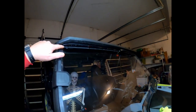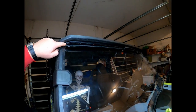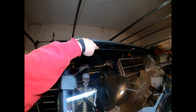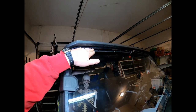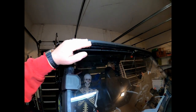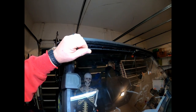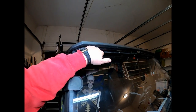I decided I needed something to give it just a little bit of stiffness — something to help it stay in place. What I did is I took a half-inch piece of aluminum from Home Depot, four foot across, cut it, and shaped it up here in the window and the same on the other side. I had some leftover body pop rivets from my Commander, so I used those. I used flex seal spray on it so it wasn't hard contact — it had a nice cushion between the aluminum and the plexi. Because if you put straight plexiglass against aluminum or steel, after a while they'll start working against each other and you could get stress cracks, hazing, all kinds of bad things.